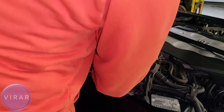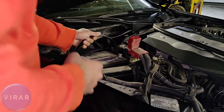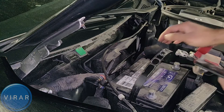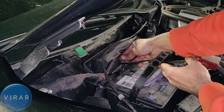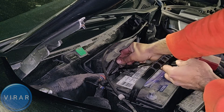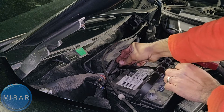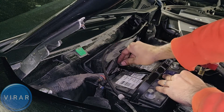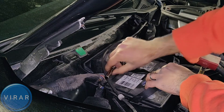Now let's get the new battery in. When you put the new battery in, make sure it's facing you — the two connectors are sort of facing you. You don't want to put it the other way around because then you'll have to get the battery out and put it back in again, and you don't want to do that because the battery is heavy. Once the battery is in place, get the retaining plate with the short rod. Because we loosened the nut a few turns, we should have enough play to get the rod under the hook — just the way shown in the video. Once you do that, make sure it's sitting there, then tighten it up with the wrench or socket ratchet combination.